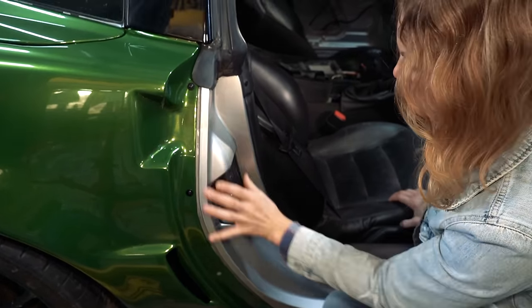It's gonna be good. If you guys have never painted a car, to prevent this nastiness, all this overspray, it's just awful. They sell foam, it's about half an inch, and it's sticky. So stick it to here, shut your door, and there will be a little bit sticking out, and it'll make you a perfect clean line. So you got new paint on the outside and no overspray on the inside.